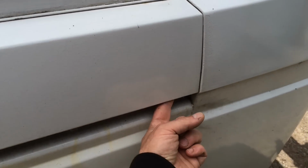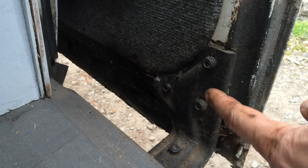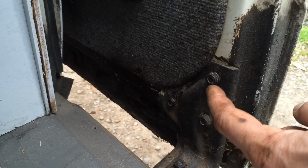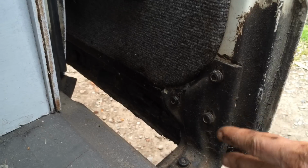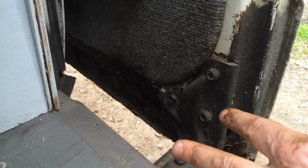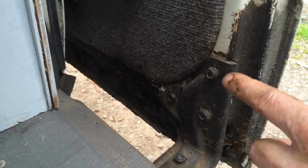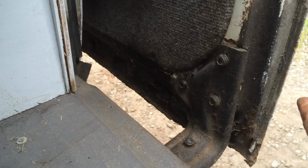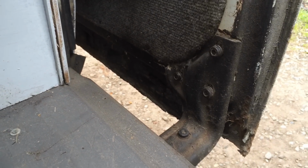So as it's just me here today on my lonesome, I'll be doing that myself, so I can't film taking the screw out. But anyway, I'm now going to take the screw out of there. Also loosen these 3 screws, Allen headed socket screws. Just loosen them enough so that the whole door and this roller mounting plate can move freely, because you need to lift the roller up slightly to pull the door out at the bottom.